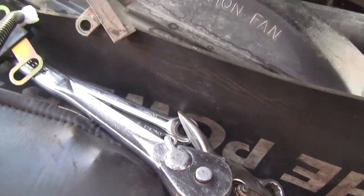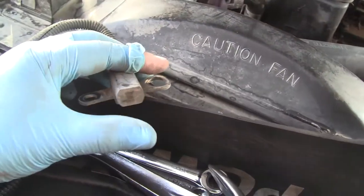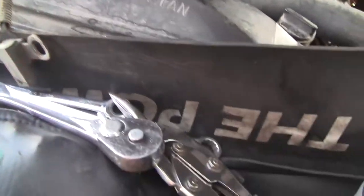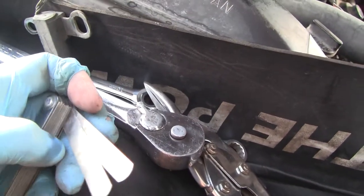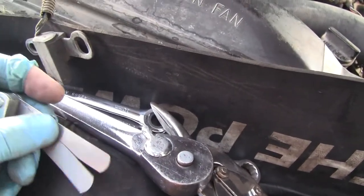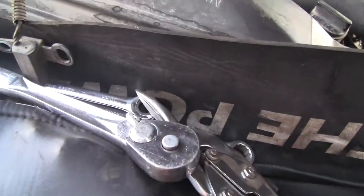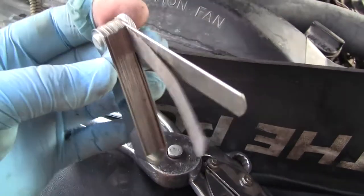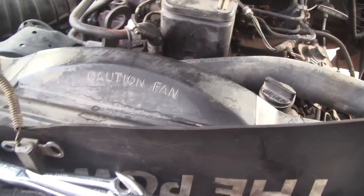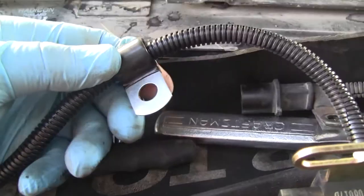Use whatever you've got — I wouldn't be afraid to use steel even a little bit. In fact, the magnetism may actually help hold your feeler gauge in place, which is going to be helpful down there. Here's my suggestion: take your 15 and 35 thousandths feeler gauges off your set, put some tape at each end, stick them in there, let the magnetism hold them, then push down on the sensor, tighten the nuts, and pull the gauges out. It shouldn't be any harder than that.